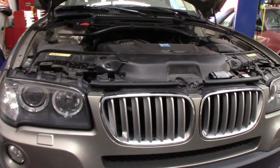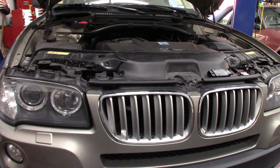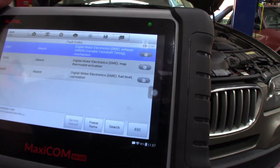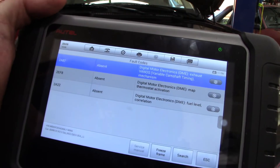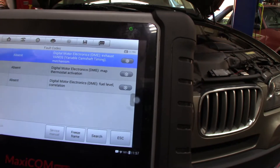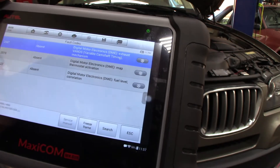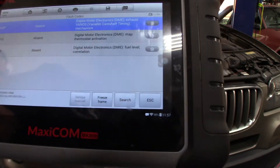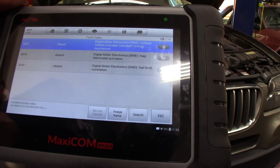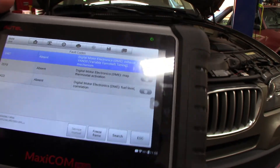It's in really good shape except it's got one of the problems that some of these engines have. We've got the N52 in here — it's the 3.0 SI. We kept getting error code 2A87, which is fairly common and it's the Vanos solenoid. In this case it's the exhaust solenoid. I'll put a link to a BMW bulletin on how to fix this. They recommend replacing the oil and both Vanos solenoids, and even pulling the Vanos to make sure it's not worn.